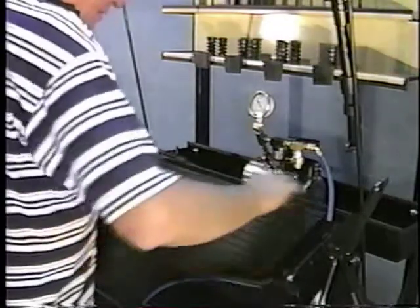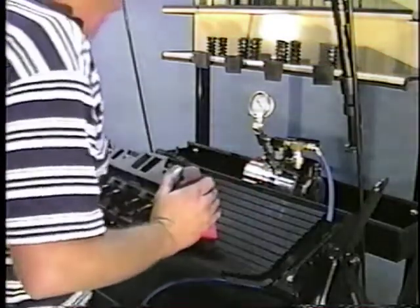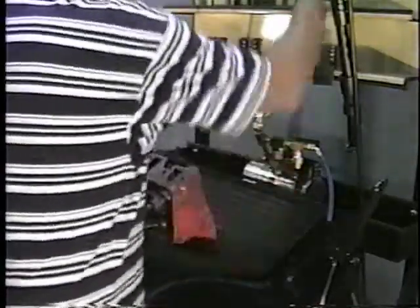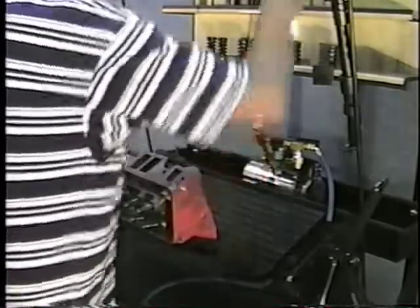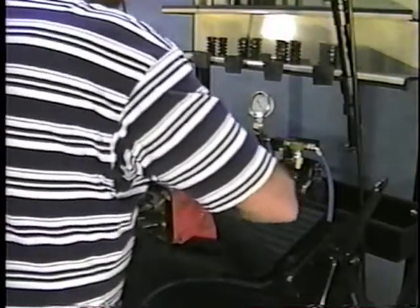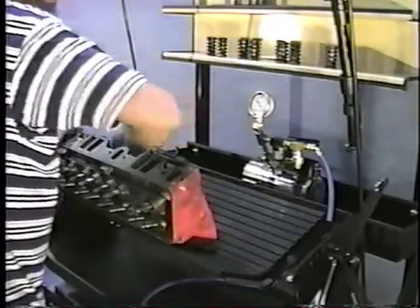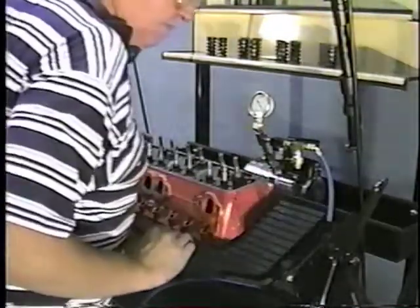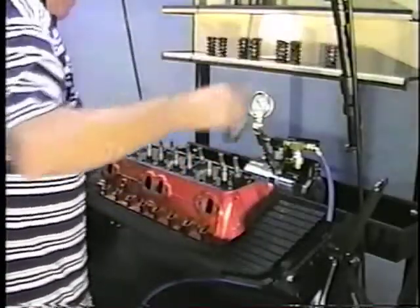Here we've made a production plate, which is rubber lined, and the head stands up on the exhaust side. You install the valves — looking through the ports, you can actually see and line them up. Install all the valves, and then there's a little foam pad, a magnet foam pad that holds the valves in place. Flip it down, and then we install the springs with the keepers and the retainer.